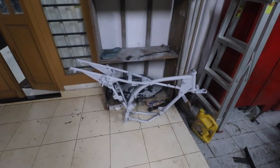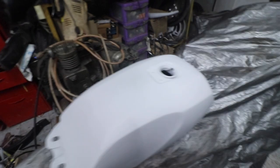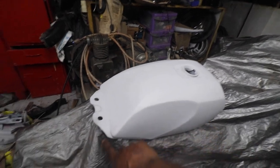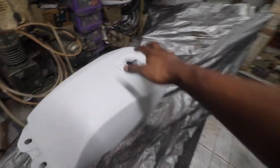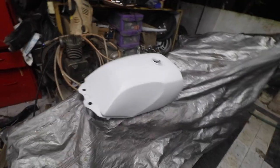Update on the Shogun: we got almost every part of the bike primed. This is the chassis which is primed. We also got the tank primed — the tank has some bodywork to be done: there is a small dent here and some scratches. The reason I applied primer before doing anything was to prevent rusting. When you strip the paint that is when you see the beautiful contours of the tank — there is absolutely zero dent on it except one small dent here and one here. We'll fill those using body filler, sand it down, then give it another layer of primer.